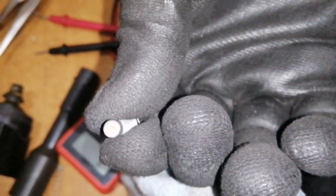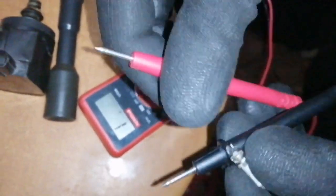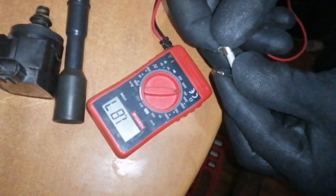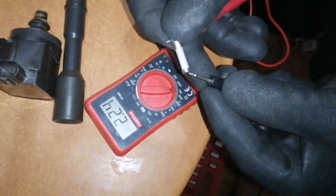So I'll be rubbing the end part on the rag with metal polish. It's difficult to see, but it's not shiny now. Before I do that, then rubbing it. Okay, you can see the bottom side is shiny already. So let's test it again. And yeah, as I mentioned earlier, the value of it is around 1.9, and we're reading 1.87 kilo ohms.